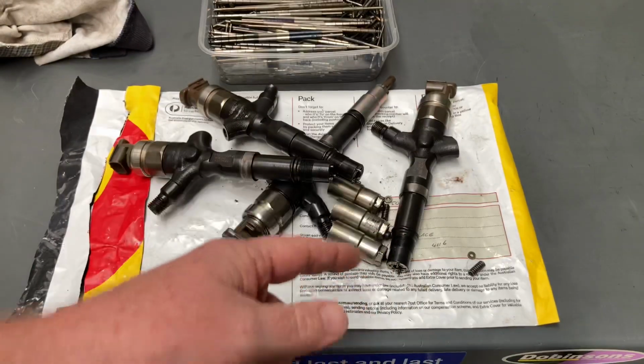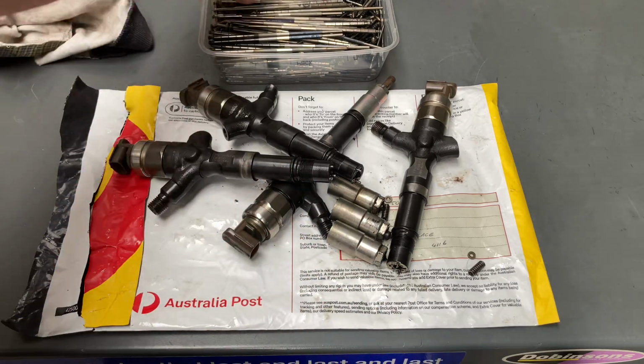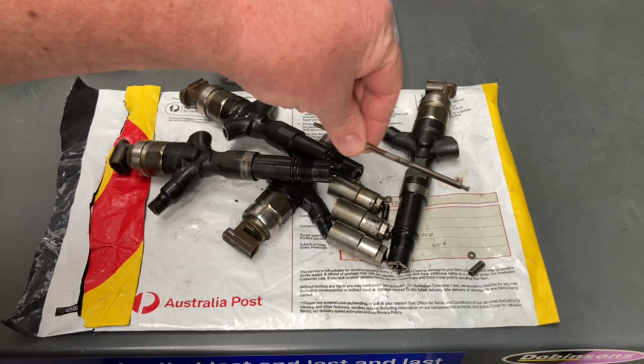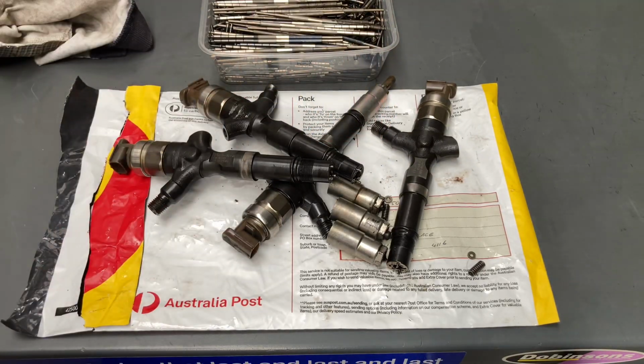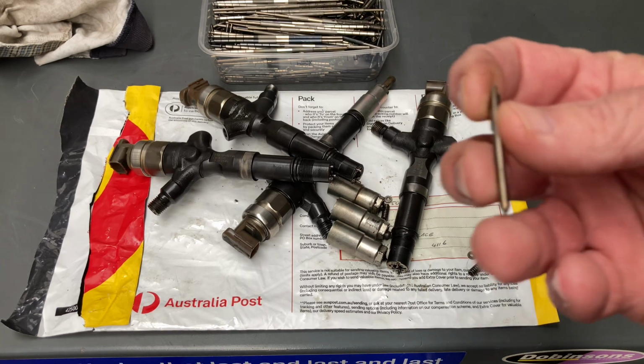And then they replace this, maybe the nozzle and the nozzle needle, put it back together, and then they recode the injectors. So your old, worn, contaminated command pistons like that don't even come out of there, is my understanding. I could be wrong. Maybe they do come out, get cleaned, and go back in. But either way, the reman ones that have been stripped down that we've seen have got old parts in them. So in my opinion, you shouldn't be able to call that new.